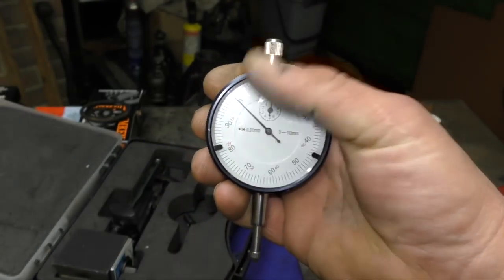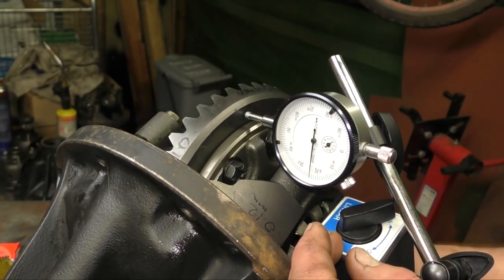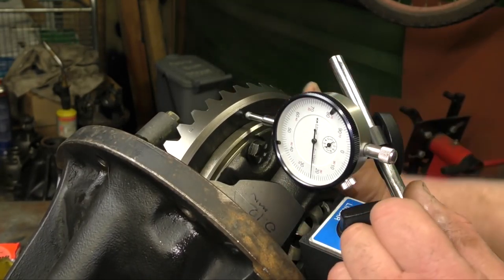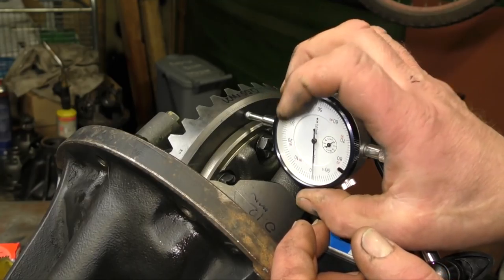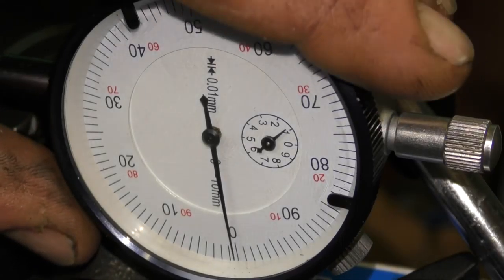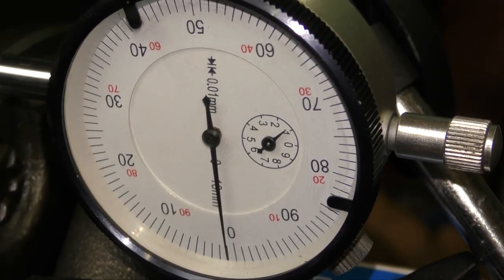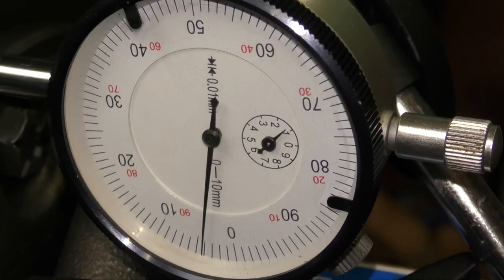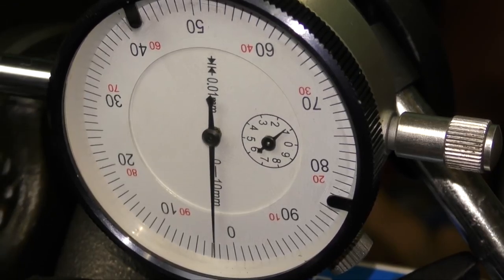I've done plenty of videos before. The dial gauge is one of the things you use with Land Rover engineering - basically measuring the run-out, which will be the same as doing brake discs. What we're trying to do here, you can see the stylus is actually preloaded. I'm looking for hundredths of a millimetre, so that'll be from the region of 0.00 to 0.10. When you set it up and you've preloaded it, you want to get it to zero and find the lowest point. Once you've found that, set it again to zero and then run it until you find how many hundredths of a millimetre actually moves.